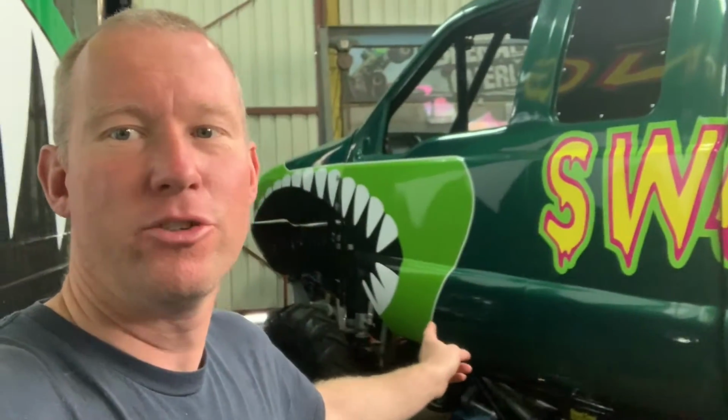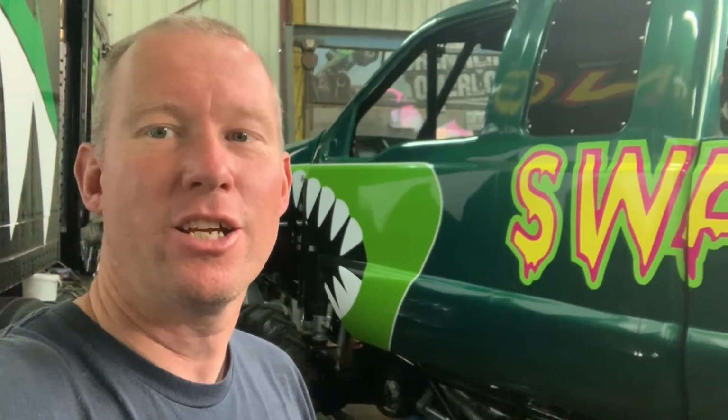So on the front of my truck, it's 11 inches, and at the back, it's set at 13 inches from the bump stop. So that's its ride height. We do have to check it before we do the show, but we have to lift it up, because at the moment it's so low, it actually won't go in the trailer. It'll actually bottom out on my ramps on my trailer when it climbs in. So we've got to get it set somewhere near right so we can take it to the show, but we will recheck it when we get to the next show.